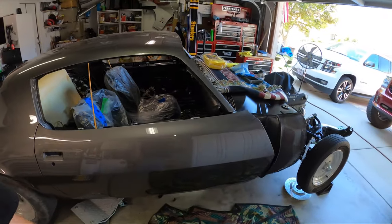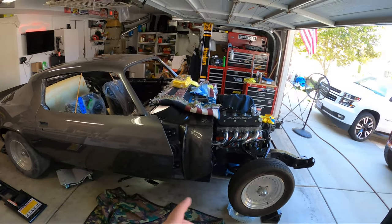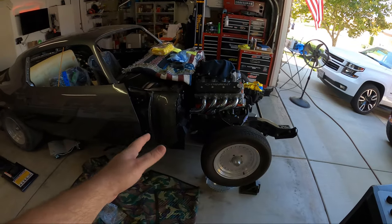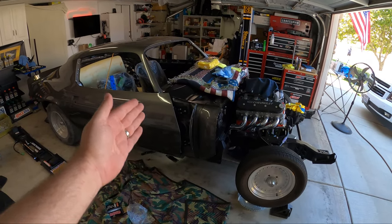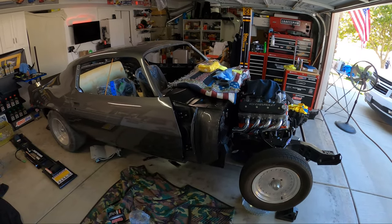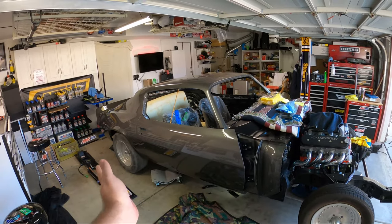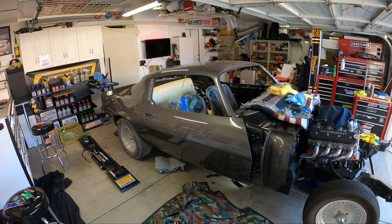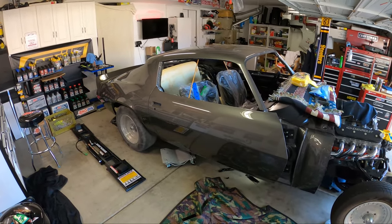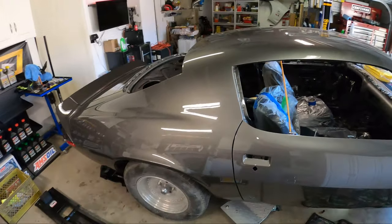The doors are as lined as they can be until we get the fenders on. The next step is going to be the fenders with the inner fenders. We did get some adjustment on this side — we had a big gap between the A-pillar and the door, and we got those basically dialed back in. I don't have all the hardware in the doors yet, so we have bungees keeping them closed. Everything is looking good — I'm super excited about how it's all lining up. The body lines look really good and our gaps are looking good.